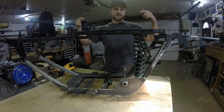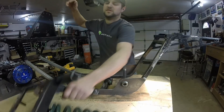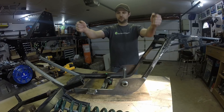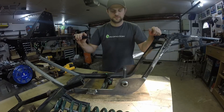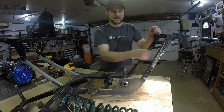I'm thinking about the tank and I don't need any of this stuff. I'm going to make the tank part of the frame, and that way I can bring it up here and make it a little bit higher, then have it actually bolt to the top part of the frame — that's what's going to hold the tank in and be the top frame structure. It's going to save me a little bit of weight, and I'll remount the shock to the back area.